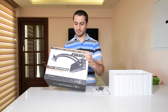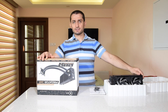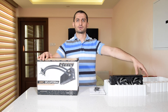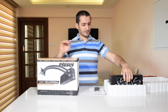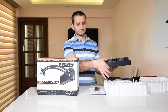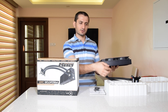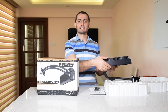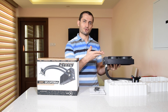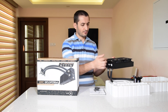Before proceeding, just some measurements so you have an idea. The length of this cooler is 295mm, so you need to measure before adding it to your case to make sure it fits. It is 68mm tall — you need to make sure, if you're going to stick it to the top of your case, that there is enough clearance between your motherboard and the case top where you're going to screw it, in order not to damage or cover your motherboard. And it is 133mm wide.